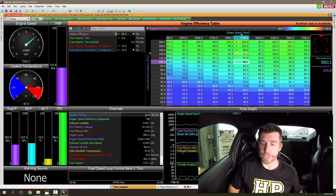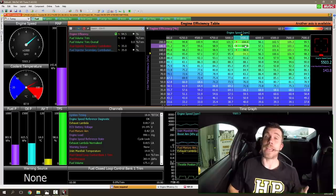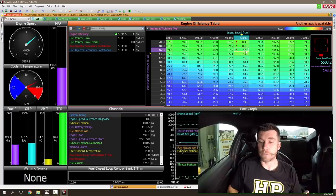Particularly when you're a little bit more confident with your tuning, you may choose to jump ahead in 40 kPa increments of boost. For example, looking at our volumetric efficiency table — let's say we had accurately tuned our fuel at 140 kPa and our next increment was 180 kPa. This leaves a zone at 160 kPa that we haven't accessed or tuned. In that case, highlight between those cells, between the cells we have tuned, and using the interpolate function — the I key — what happens is the 160 kPa zone simply gets filled with the value halfway between the two sites we have tuned. This might not be absolutely perfect but it's very close, and it's a quick way of helping fill in our fuel and ignition tables in areas we haven't tuned.